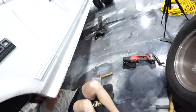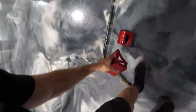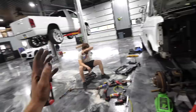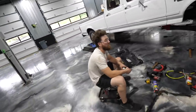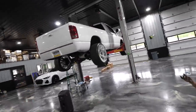Jake and Josh have been absolutely crushing it — they got the right side on, and all the cross members have been notched. We only have one more side to drill before we can call it good. That lollipop red on the interior is a pretty glorious combo — I absolutely love it. The last thing we need to work on are the sway bar drop brackets — very simple, they just mount right up in there. We did all this in one video — truthfully it was a bit of a stretch but we got it done. All it needs is a coil spring and a track bar and it's considered suspended. Then we can get this thing off the lift and over to where we can work on the remaining suspension.